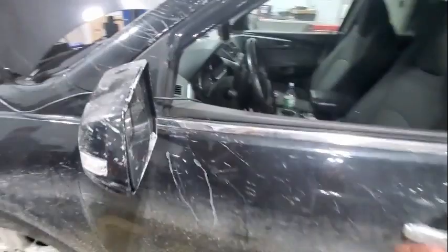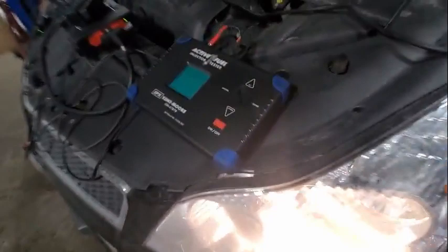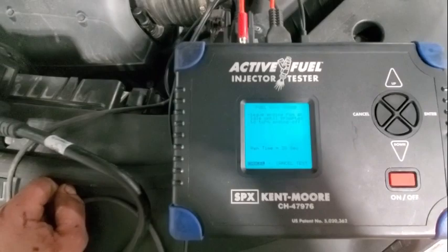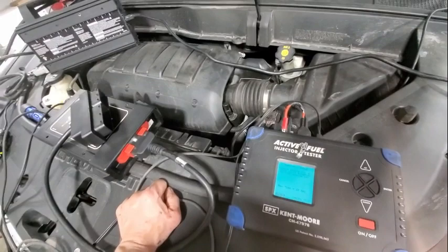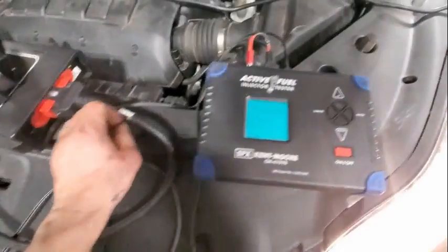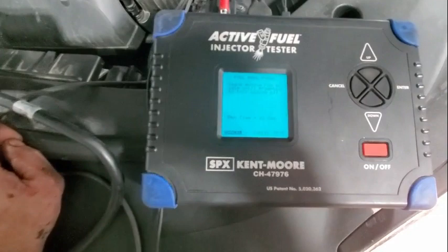I'll give the park brake a click just to set the light — don't want to make it mad. Leave engine running at idle until prompted to turn engine off. Great, now it's getting a base value stored. Almost done. Turn engine off — when engine stops, leave key off with engine off, press continue.